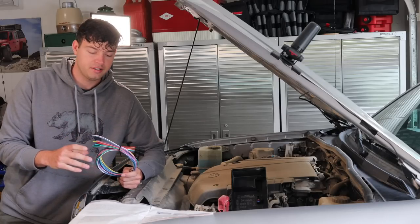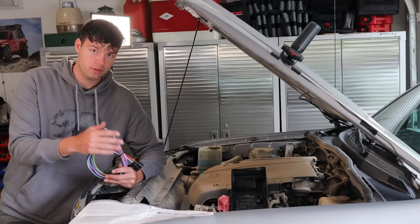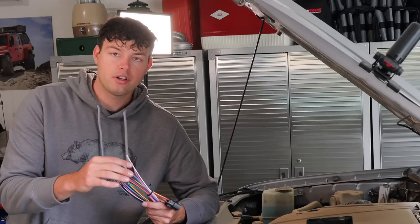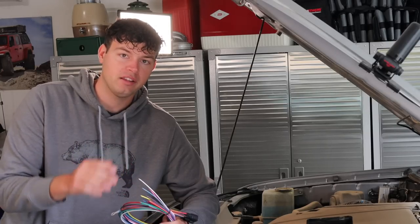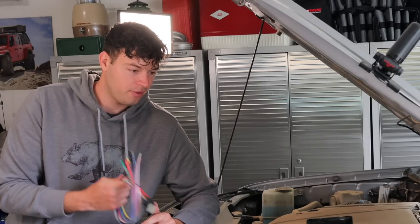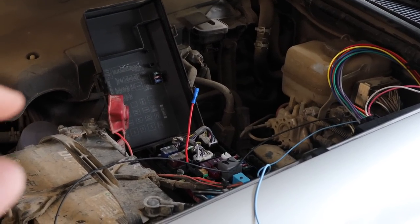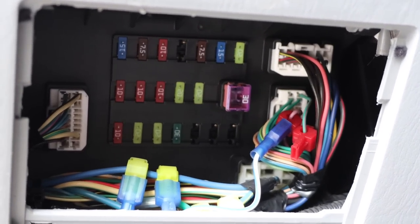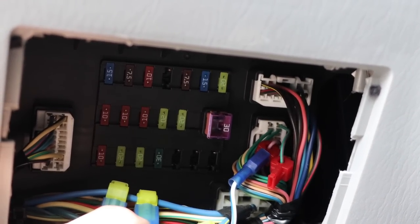From the instructions, this main wire loom has a few wires that need to go a few different places. There's a ground, and then there's a light blue wire which needs to go into the 12 volt circuit. I checked the owner's manual — I'm going to use a fuse tap and get into the audio system and run that into there. There's another wire that needs to be tapped into the parking lights on the truck so that way it controls the backlight on the controller. After putting the wiring harness in and laying out the wires, I'll take this fuse tap into the interior and tap it into one of the fuses. The wire is pretty long and should definitely reach.